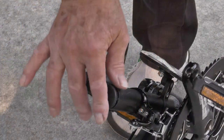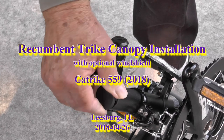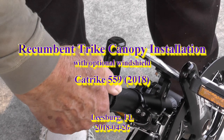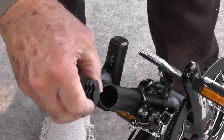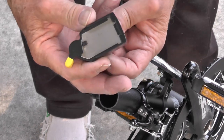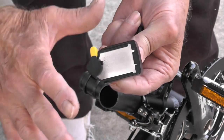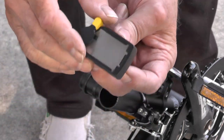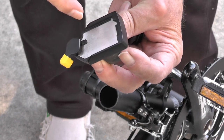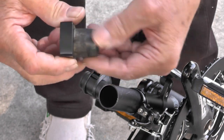First thing I'm going to do is take this plastic derailleur end cap off. Just a plastic plug that will pop out of there. We'll remove that so we can put our quick disconnect in. When you're putting this in, make sure this little button is pushed in so that the lever is over here, so when you're turning it, you don't dimple this little plastic plunger, because if it's dimpled, it'll go down in there and it won't pop back out. So just go ahead and trip that, and let's see if we did.